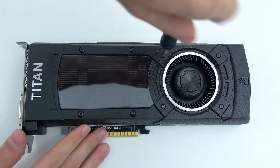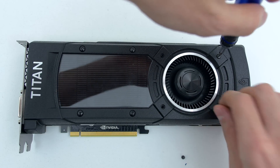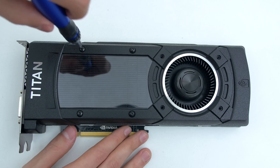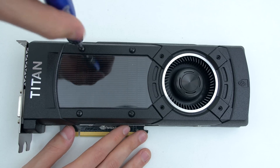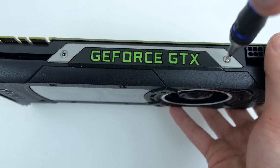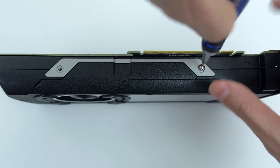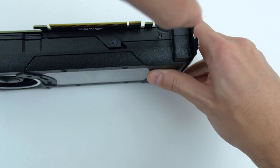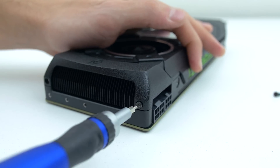Next step is to remove the screws off of the GPU. The four screws around the fan require a smaller hex bit and the four screws on the left require the larger ones. Some of the screws are glued in tight so you will need some force to twist them out. The next set of screws to remove are from the sides — there are a total of two silver screws holding the silver plate on each side of the card. After that there are two more smaller screws near the back of the GPU and two more in the front that need to be removed.